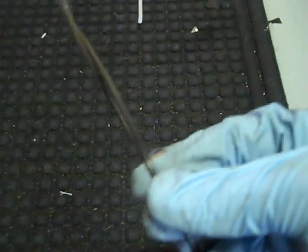And this is the old airline. I pulled that out of the whole car — it has little clips on the frame. I'm going to reuse those same clips when I pull this out, so the airline on top of the frame will stay nice. See how skinny this was for the air shock. And this is that stupid connector that was giving me a pain in the ass. Now I have this style connector on the compressor dryer.